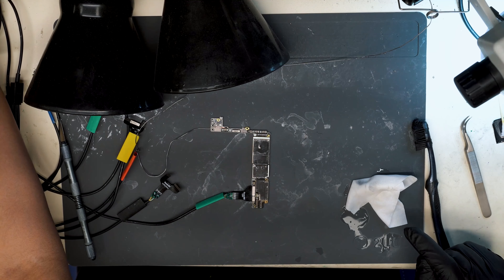Let's take a look at this IC here. As we can see, there's quite a bit of corrosion near it. It's U5000 — on the iPhone 8 Plus, this is the speaker audio IC. If we look beneath the chip, we can see there are I2C lines. If there's any significant corrosion beneath the chip in this area, it could very well cause the boot problem we witnessed. Let's switch to the microscope view and remove this chip from the board.